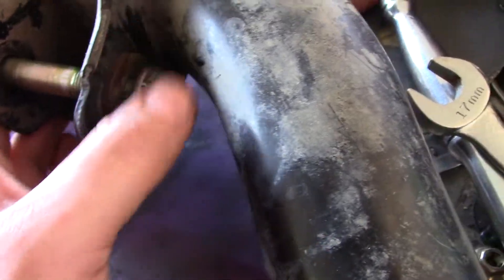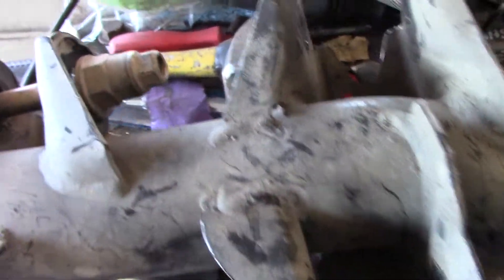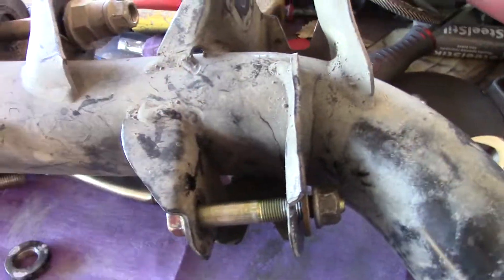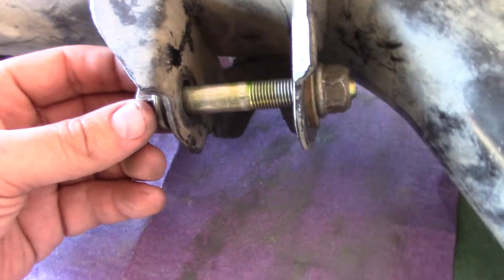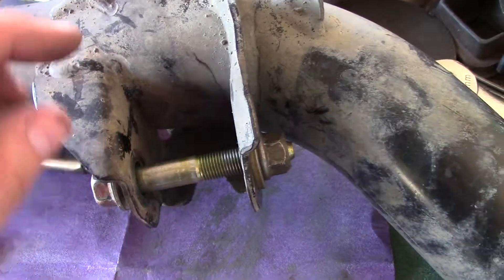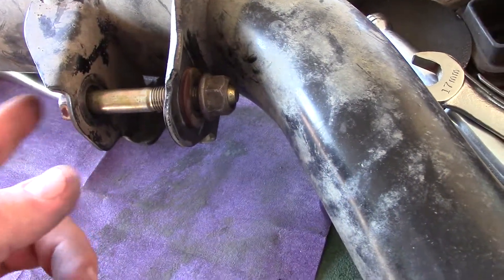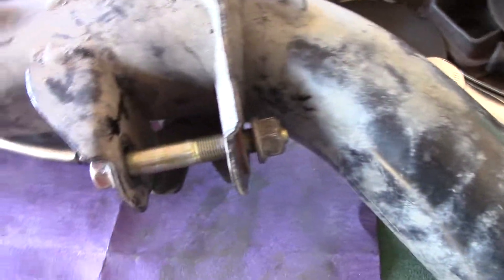That's all you do. The only differences are in the width — that's why I use the CRV trailing arm. There are slight differences but they make a difference. You don't want the Element trailing arm because it sits lower; the CRV one is fine. Once you have this on, I've already bolted it up. This is the size you're going to need for the EM2 and RSX. I thought it was going to be a lot more complicated — I tried grinding it and all that, but you don't have to. Just tap it and it pops right off. Thanks for watching.